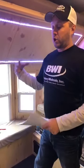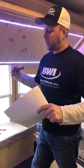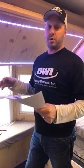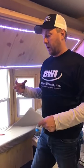But what I want to show you guys is, you start running all of this stuff and you start getting the stereo, you put your amplifiers and your speakers in there and you start really pulling the wattage, you're not giving the batteries a fair chance to get recharged when you're only starting with 60 amp hours of capacity, okay?